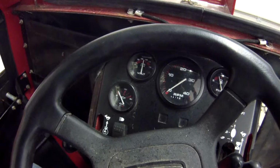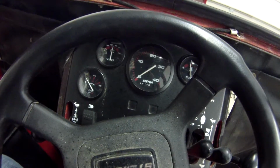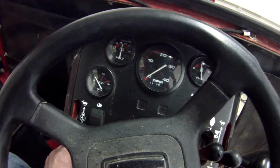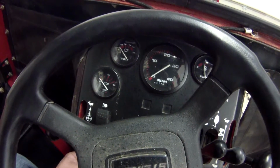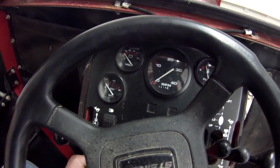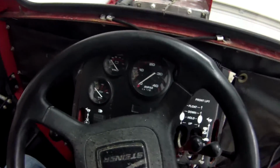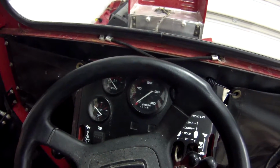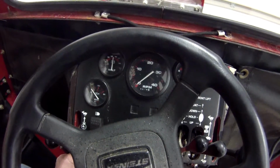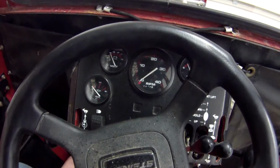As you can see, I got the ignition on. Look how low that oil pressure is going, and my low oil pressure light still isn't on. So that tells me that these things have to get pretty low before they trip, or something's going on maybe with the wiring. I don't know, I'm gonna continue to mess around with this. If anything fails, I'll comment below and let anyone know.